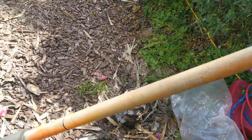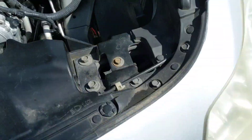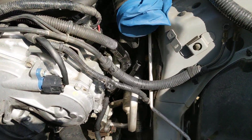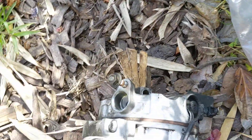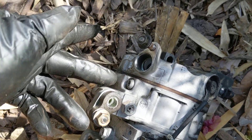This is different than the VQ35 DE engine, and the AC compressor is different too. So don't assume it's the same compressor before you buy one for the vehicle — double-check the bolt pattern, and not even just the bolt pattern but the actual output, the high and low side output from the compressor.